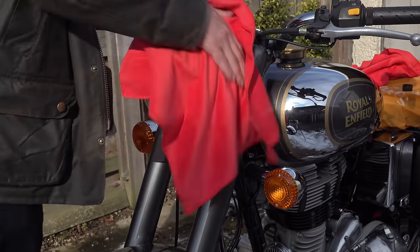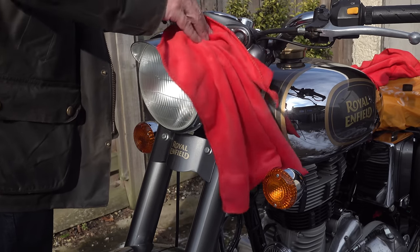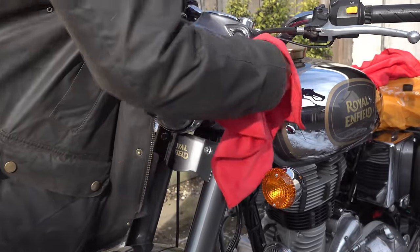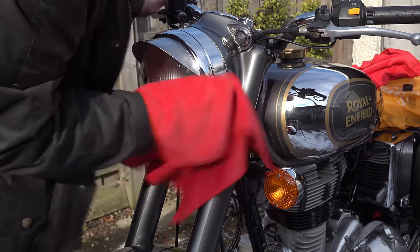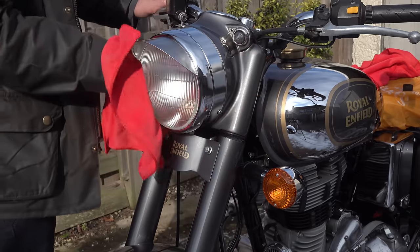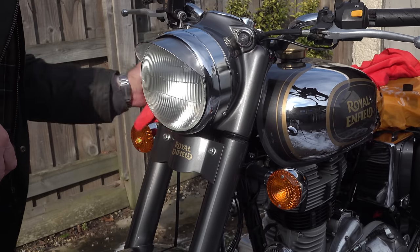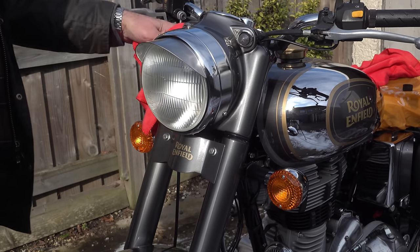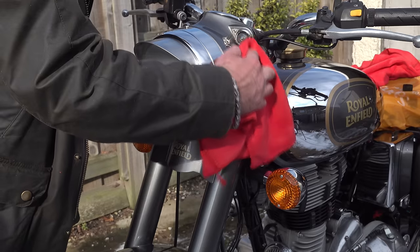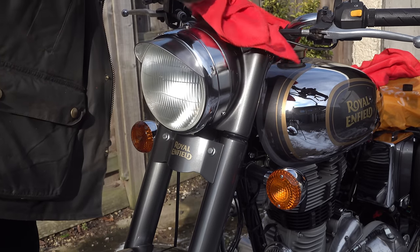In fact, apart from using some very skillful high-end machine polishing, I wouldn't really have thought that this kind of finish was possible. The only things that it won't rectify, obviously, are things like stone chips. Autobrite Direct say that this particular product is suitable for use on paintwork, chrome, polished stainless steel, apart from areas that might get hot. Not that that would cause any harm, but obviously the heat is just going to burn this product away. So it's safe for use on your handlebars, all your chrome bezels on your headlamp, your paintwork, your wheel rims if they're chrome, and even all the accessible areas of your frame if that's how far you want to go. They recommend after treatment a curing time of 2 to 4 hours depending on the temperature.